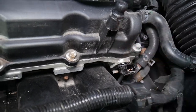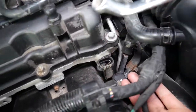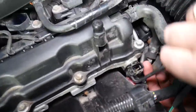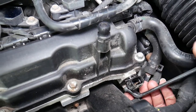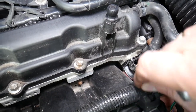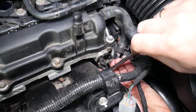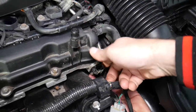With that disconnected, you have only one bolt holding the camshaft position sensor to the cylinder head — it's a 10 millimeter. We're going to use an offset box wrench to reach it, because there are a few hoses that will prevent you from getting to that bolt easily. If you don't have an offset box wrench, we'll put the link in the description where you can get one for a really good price.